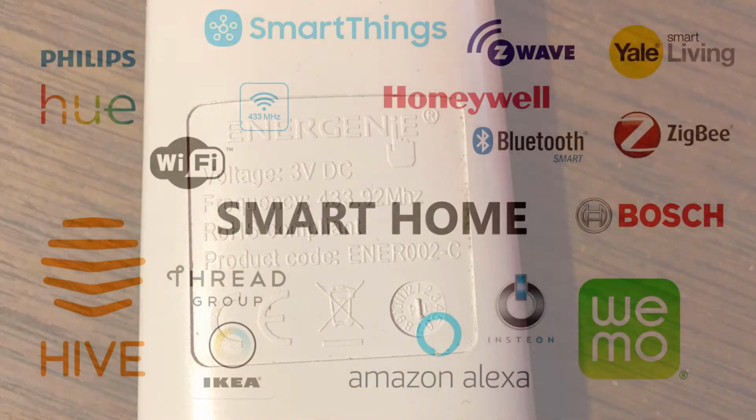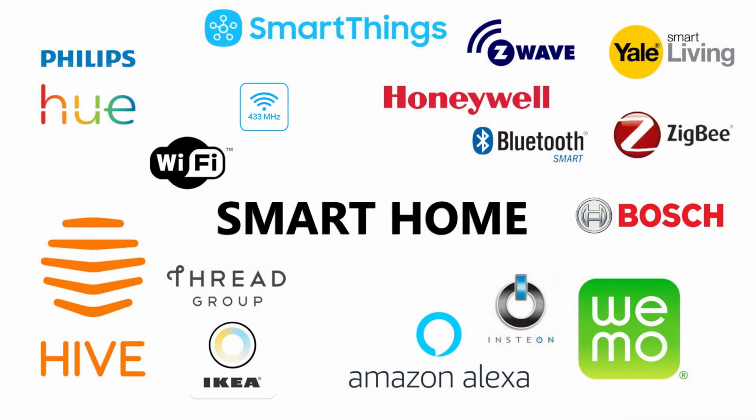The first thing you would want to do is to identify the method the device is using. If it's using an app, it's super easy to know as it would require either Wi-Fi or Bluetooth enabled. For devices with hub and remote, well, if the remote requires line of sight, then it's most probably using infrared. With a hub, it's a bit harder to determine. In that case, your easiest option is to search on the internet.